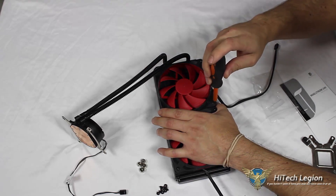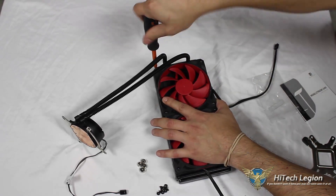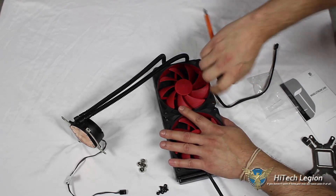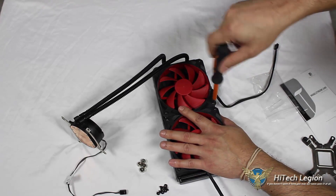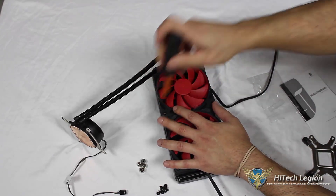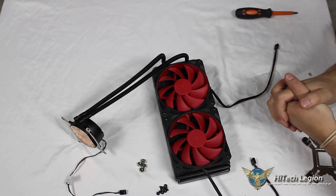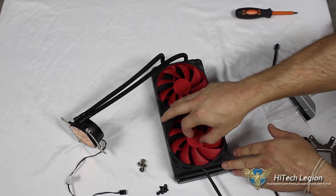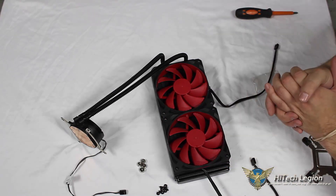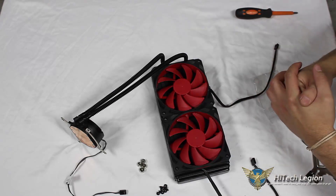We'll go ahead and get our other fan mounted. Most of the time you can drop the screws in place and line them up before snugging tight, so you don't strip out the screws into the radiator. You can see the lip difference when a screw is loose vs. when it's snugged down — it sucks right onto that rubber. Don't over-tighten; just snug. For cleaning, since the fan blades are removable, you don't necessarily have to take the whole fan off the radiator — a little compressed air works, or remove the blades and wash or clean them with alcohol.